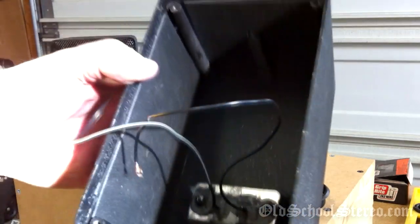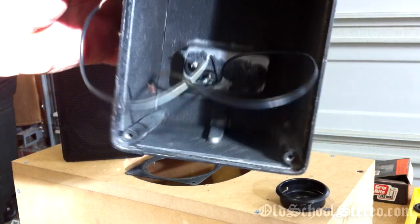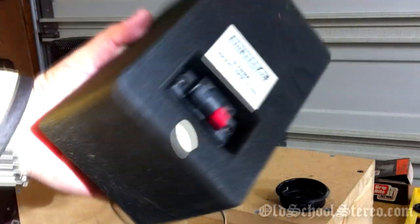And since these enclosures are metal, what I've done is I've coated the inside with Dynamat style material. Sound deadening material, if you will. And you can see it's already got wires connected. I'm gonna desolder these and put a little bit larger, maybe 16 gauge wire, and I'll get rid of the logo. And I may sand the outside and repaint these as well and put a Rockford logo on there instead